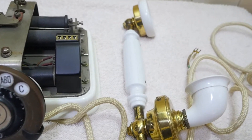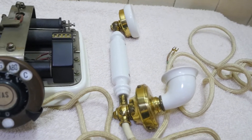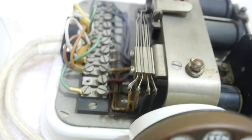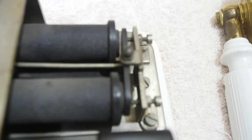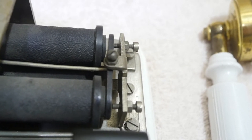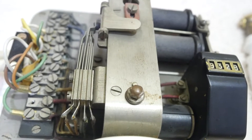On a brighter theme, I wired it up and connected it up. The bell didn't work, but there was only a strap — on these terminals there's a little strap in there, and that was just made across there, and the bell functions. The transmission appears to be good. All in all, it's a good phone and very well made. Just look at the coils and the way they're adjusted — I hadn't got to touch a thing. They were all okay. They're strong contacts.